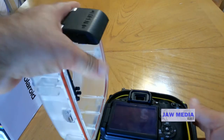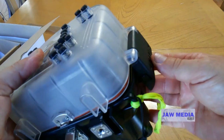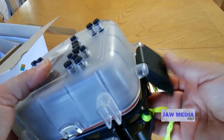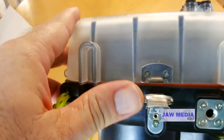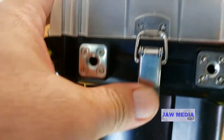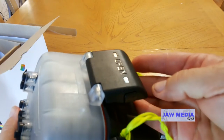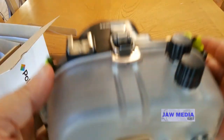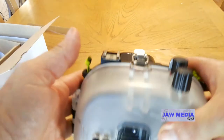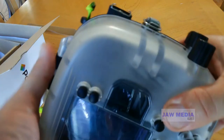You need to make sure that when you close this and snap it in, it kind of settles here. Just let it flap — don't leave it sticking up. Let it flap down like this. Then you snap the top and the lower fastening mechanism, and then the side lock — just press that in and voila. You have a camera that is locked in place and waterproof. Then you can proceed to actually turn the camera on.